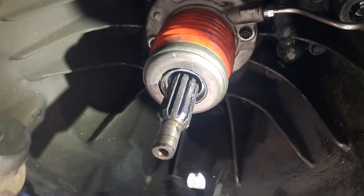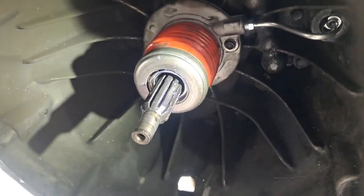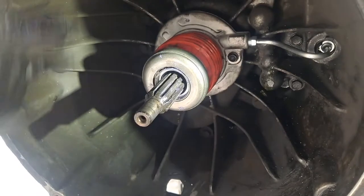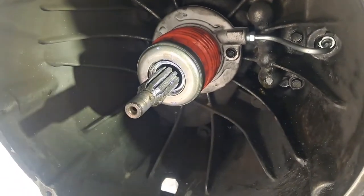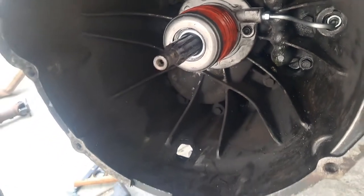This was really unnecessary because you got a full-on roller bearing rather than a pilot bushing, but it's all good, we're ready now. There's no clutch pivot, just the concentric slave and release cylinder all together. So this transmission's ready to roll back in? Oh, let's go. Amigo.